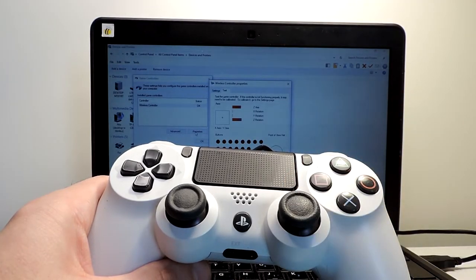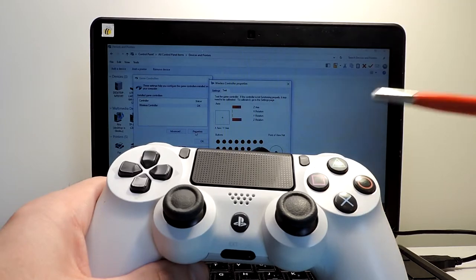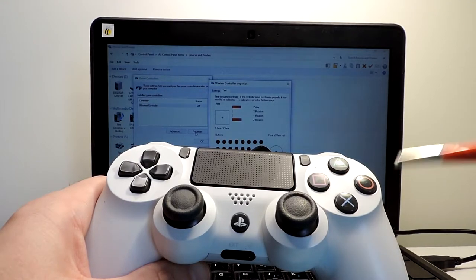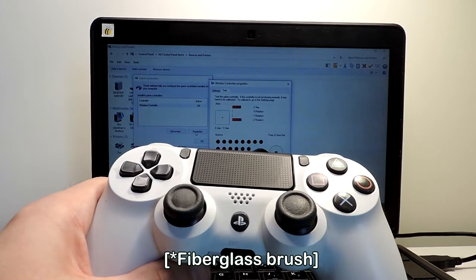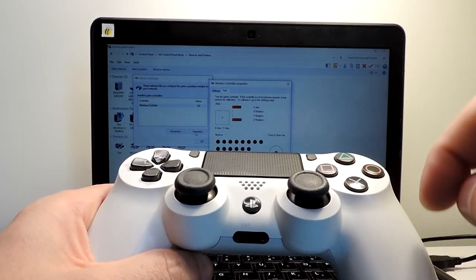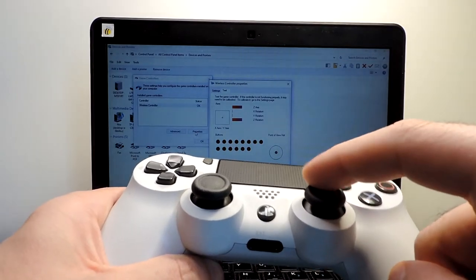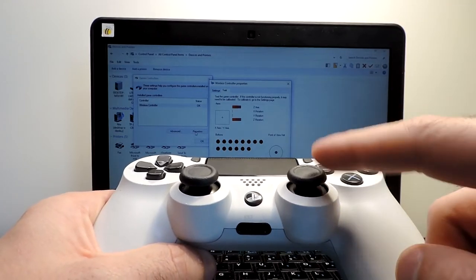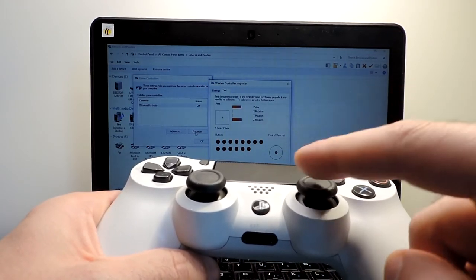So we just needed to use this pen. I will put a link in the description of where I bought this. I think I bought this from AliExpress. So this is to remove the rust. There is a specific name for this pen, but actually I forgot the name. But I will put a link in the description. And then if you need it, you can use it. Often in this kind of things, this potentiometer, usually it's worn out. So usually it needs to be replaced. But in our case, actually, it was just dirty, with some kind of rust.